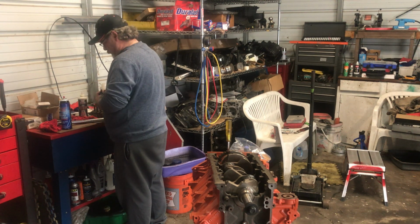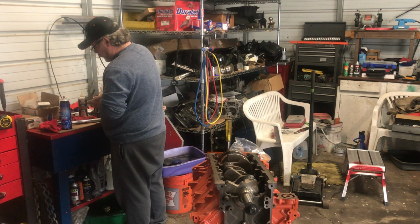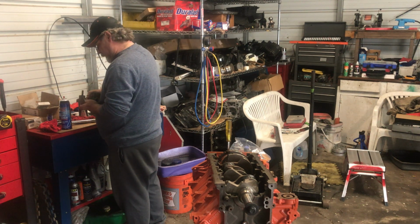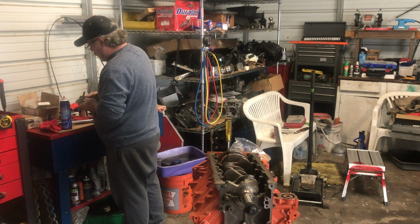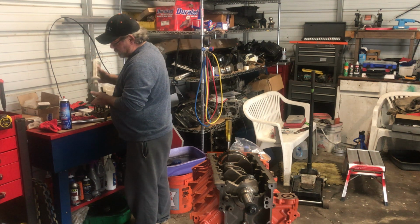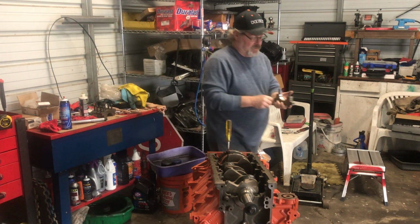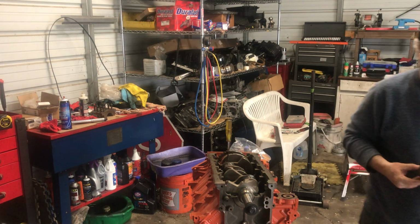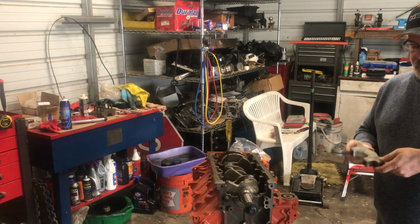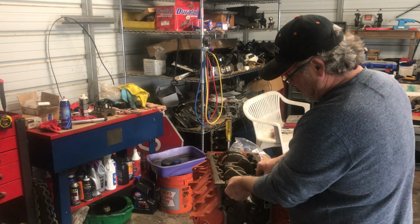You know, you hear a lot of people with torque yield bolts. You know, you can only use them once. You talk to some of the mechanics at the dealership and stuff, and a lot of times they'll reuse them. A couple of techs I've talked to, especially on the head bolts and stuff, they use them up to 3 times.